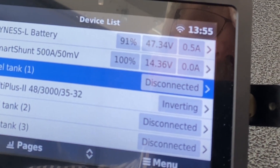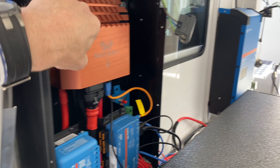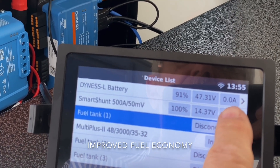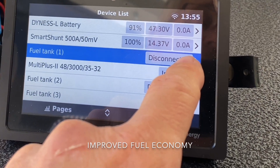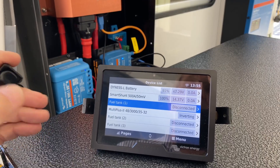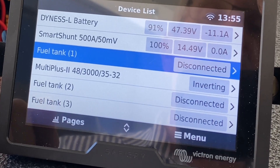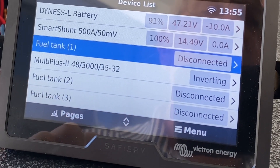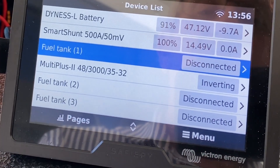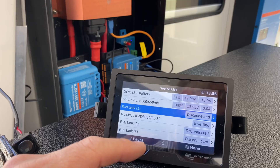There could also be loads like electric steering on the vehicle. On the back we've got the Victron Turbo, a solar controller, Scotty running, and a 3000-watt inverter — we'll do a full walkthrough on the canopy build. Right now there's no load at all coming out of the alternator, which gives the driver the best fuel economy. When they need power for the 48-volt system they switch this on and the power winds up — you can hear the engine load and unload. It's going to be quite dynamic operating between on-road and off-road mode, triggerable by vehicle speed.